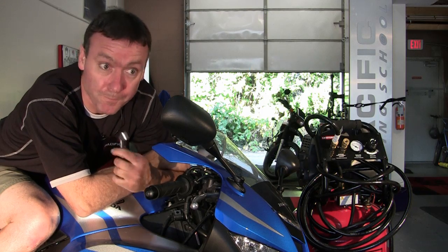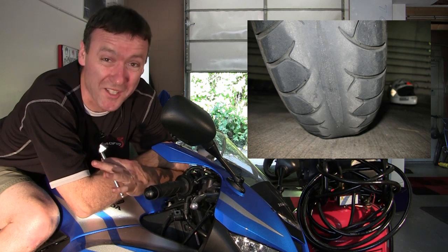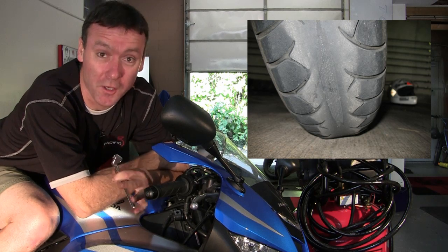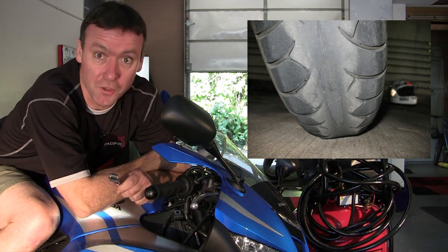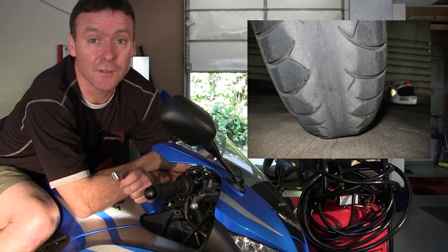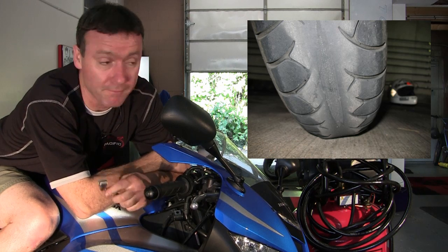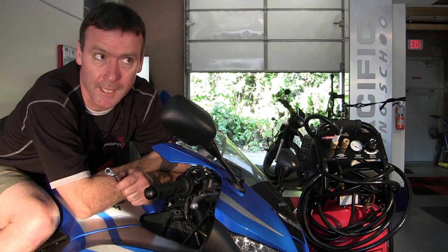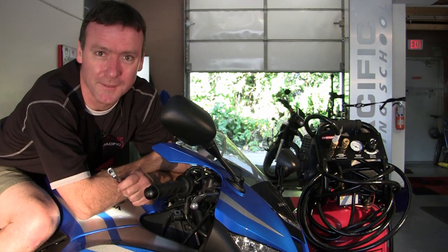All of those lead to tire wear. A properly inflated tire wears evenly, wears longer, does not overheat. Underinflated, the tire squirms, overheats, slides around, peels the rubber off instead of wearing it off, and you're throwing money down the road. And with tire pressure low enough or too high, you might be throwing yourself down the road. Not on my wish list.